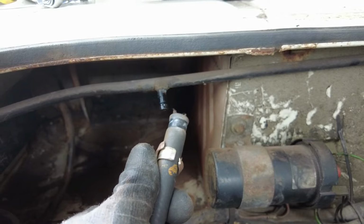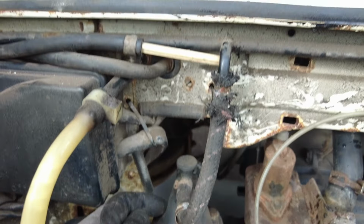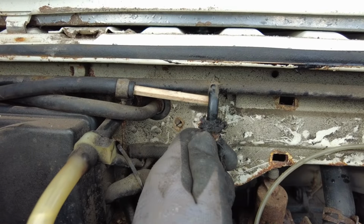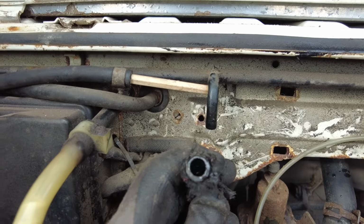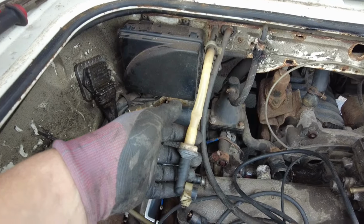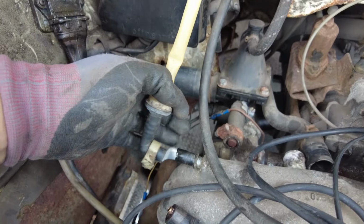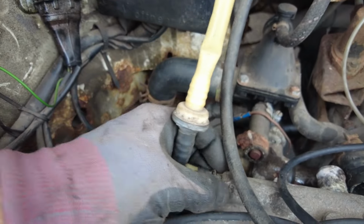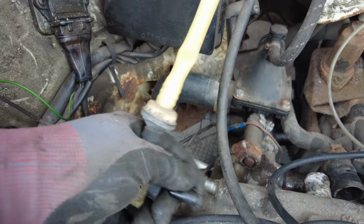with the Jubilee later. Coming from the thermostat there's another pipe which connects to the rail around the top. I have no idea how that hasn't been leaking. Definitely is replacing. Need to disconnect the vacuum line which connects to the manifold here. There's like a weird clip on the end of this one and the rubber insert and keep it all together